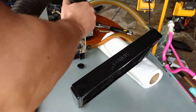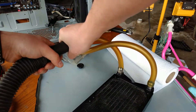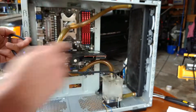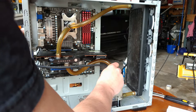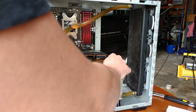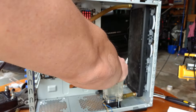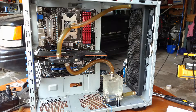Unless you're constantly upgrading your computer, I don't see a need for a proper drain in the loop. The shot glass and straw method worked well enough for me. I still need to flush the system again — I just wanted to leak test it for a while. I added a drop of dish soap in the meantime while the desktop is not in daily use.